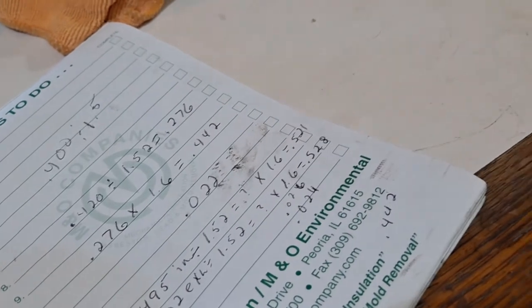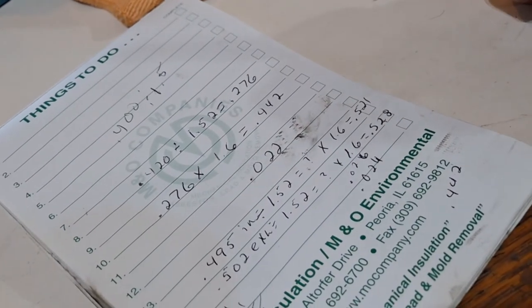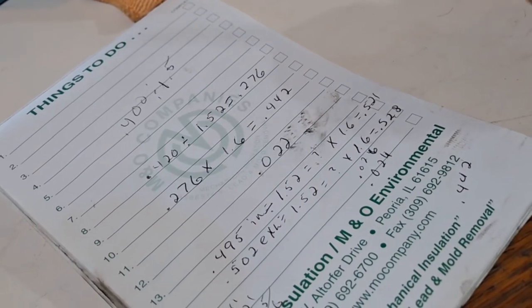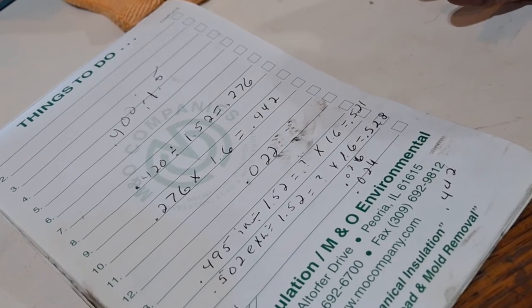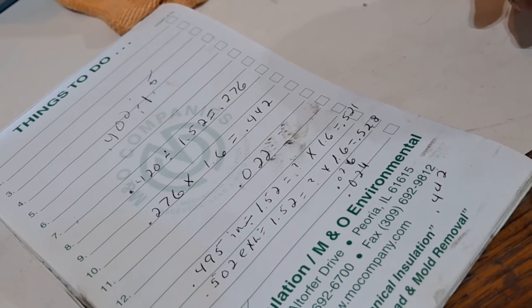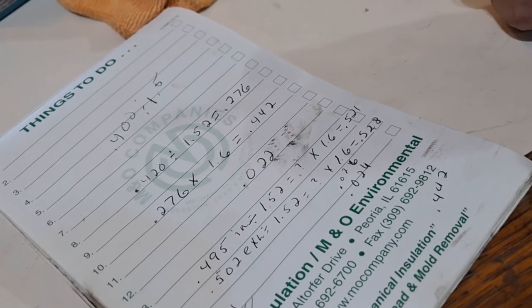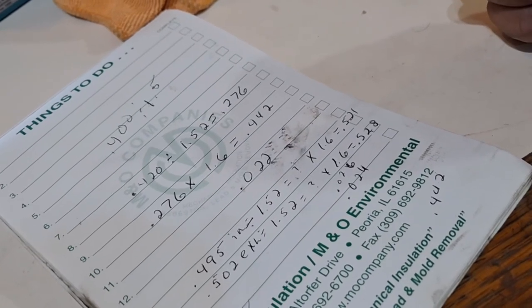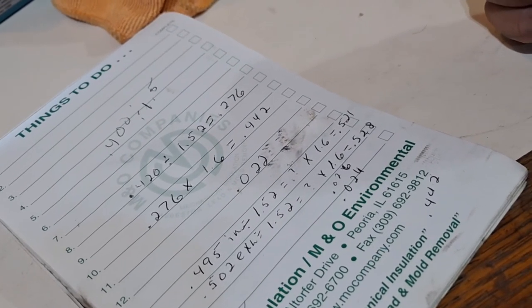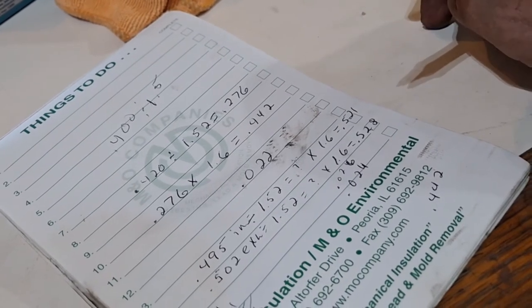So I went ahead and sent them back, and this is what I ended up with, this one. It's a retrofit, but I have a roller cam block, so my retrofit will work in it without having to do retrofit hydraulic lifters with the bar in there that holds the lifters together. Then I'm not 100% certain. I'm not sure if this cam plate will hold this thing.